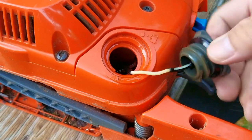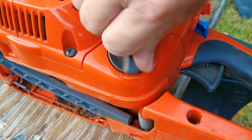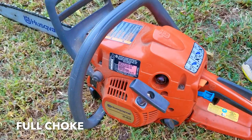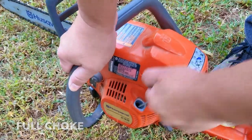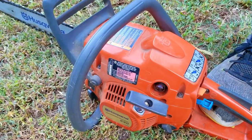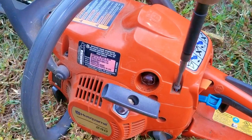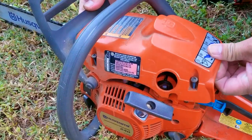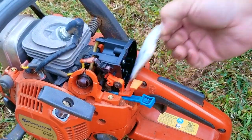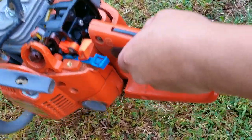The next step is to check the fuel tank — it does have something in it. Since we know it has some fuel, it's worth a shot to try and start it; you never know, it might just run. Well, there's no point in trying to lose my shoulder trying to start this one because it's not wanting to do anything. So I'm going to put some fuel into the carb's throat and see if it'll start and run on its own. If it does run, it means we have a working ignition system and enough compression, which means the engine is not worn out.